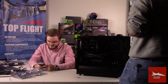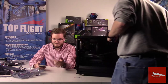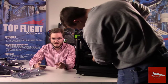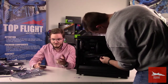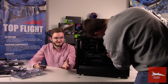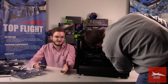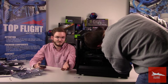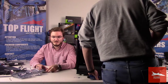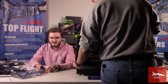So you'd have to have a motherboard that supports overclocking, a CPU that supports overclocking, and enough power and cooling to both feed it properly and cool it properly. If your motherboard doesn't support overclocking, then it won't overclock. If your CPU isn't unlocked, it won't overclock. If you don't have enough power, you'll be unstable and probably crash. If you don't have enough cooling, you'll overheat and crash.